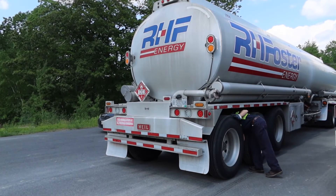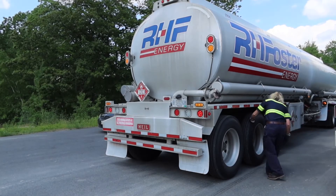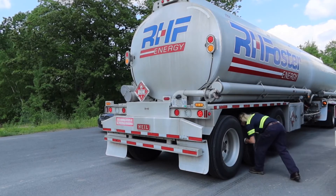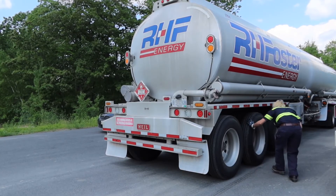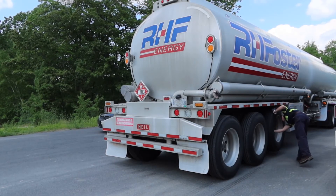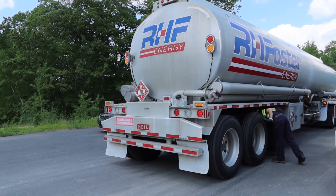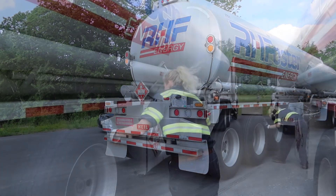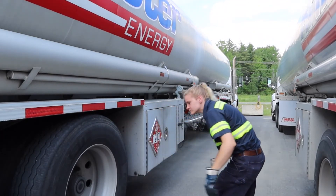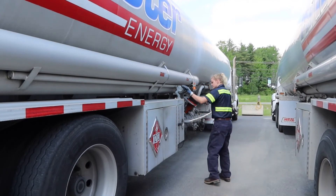Making my way down the passenger-side trailer tires — checking for tire wear, making sure nothing's bulging, checking tread depth, looking between the duals, and inspecting all rims, lug nuts, hubs, and brake components. I also check the airbags in there. Basically go through everything on each of those axles to make sure everything looks good.